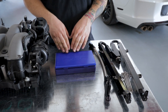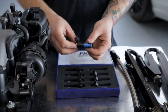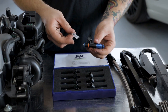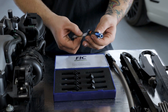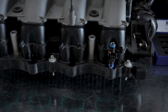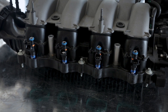For this demonstration we're using Fuel Injector Clinic FIC 1000s. These do come with hats on them to extend them — you will need the hats if you're using fuel rail spacers with the 18 manifold and our fuel rail kits. So we're going to leave the hats on, take some of our leftover super lube, lube up our o-rings on both sides, and install all eight injectors in the manifold. We'll do the same thing on the other side and then we can install our fuel rails.